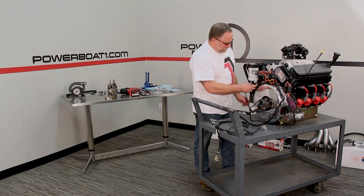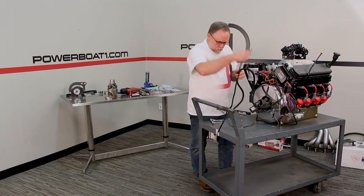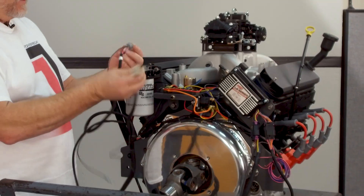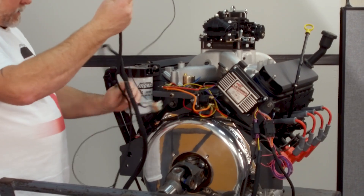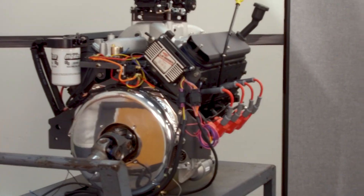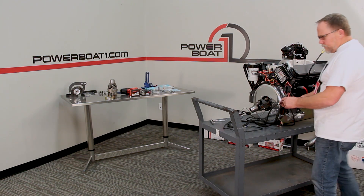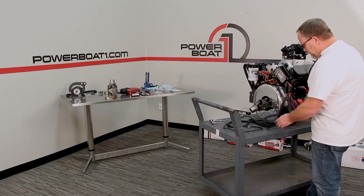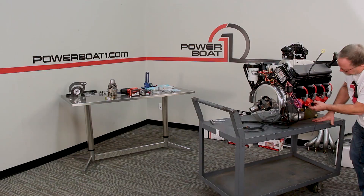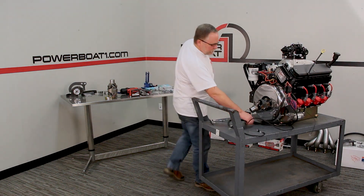This stuff will get out of the way once we get it in the stringers. Here's our coil setup — we've got a passenger side and a driver's side. Driver's side is going to run underneath there, passenger side there. This will just plug into the original coil harness that we used here, and then it'll have a ground wire that will connect up into here. So that's going to come up underneath the engine and just plug right into that coil harness. Same thing for the other side.